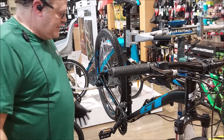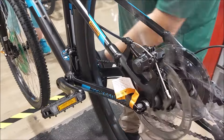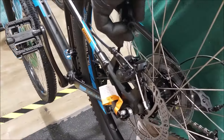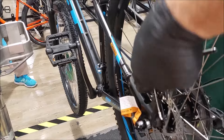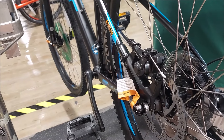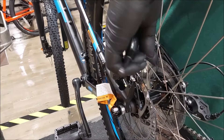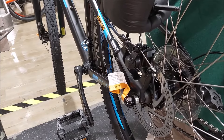You can actually hear it — it's mildly out of adjustment. I'll use a five-millimeter hex, which is a pretty common size for these retention points, and go ahead and loosen it. Now it's completely loose, so I'll spin the wheel and brake hard — everything shifts up and centers relative to the rotor. Now I gently lock it into place, centered on the rotor.